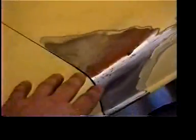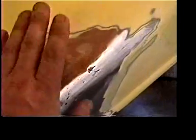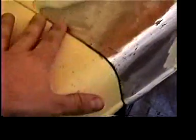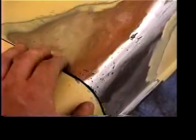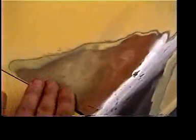The lead work on the car is all finished now, and then I went back and had to make some relief cuts in here and weld in order to get this aftermarket fender to fit an original style running board. And as you can see, it's pretty nice right now. It was really bulbous, and no matter how much beating or shrinking I tried to do, it just wasn't gonna come out.